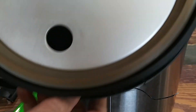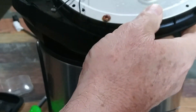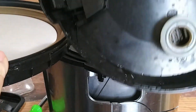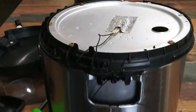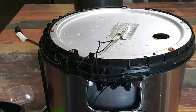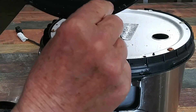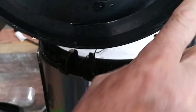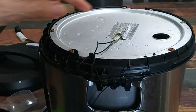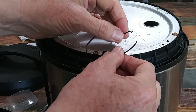I've taken the lid apart. The steam plate — whatever you want to call it where it catches the steam — this plastic piece just comes off the top, that's all it is. This metal piece tilts up a little, then you snap that apart going around the edge. It has little indentations along different places; you just pry that out. Here is your sensor right in here, and here's the broken wire right there.